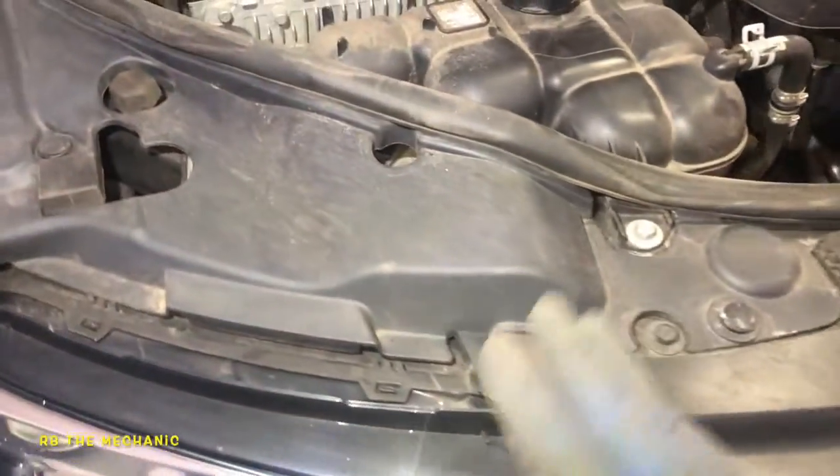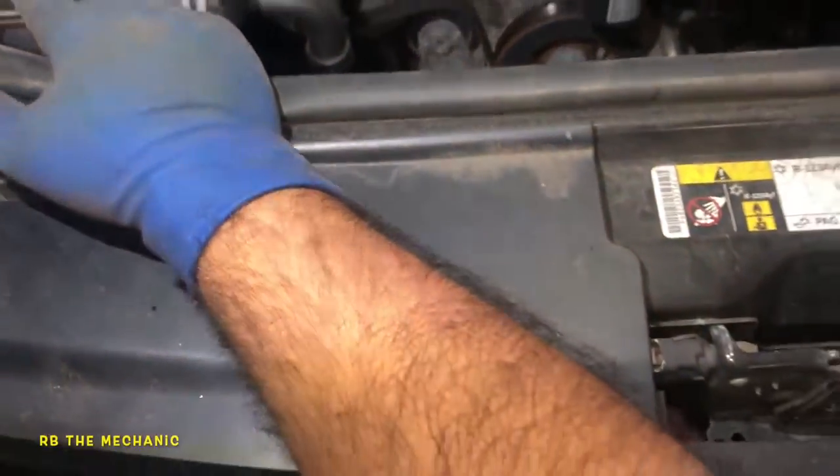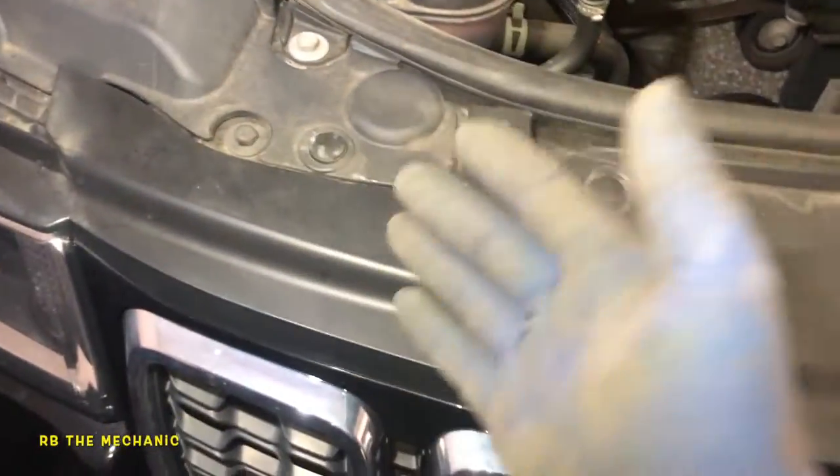Keep an eye on these things. Change out your relays and thermostat, and the fan will be the last thing you want to check. Check your antifreeze — nothing else really fails. If your antifreeze is low and keeps going low and you see leaks, that's the issue.